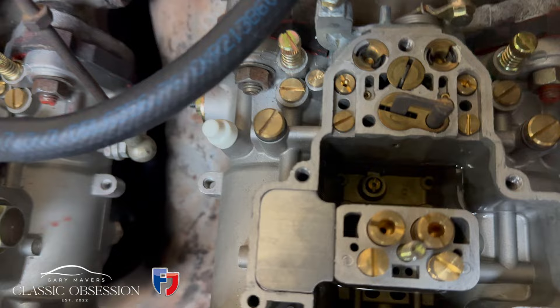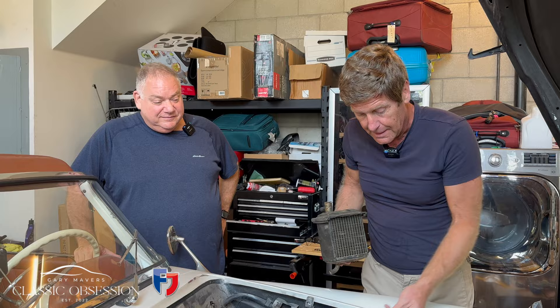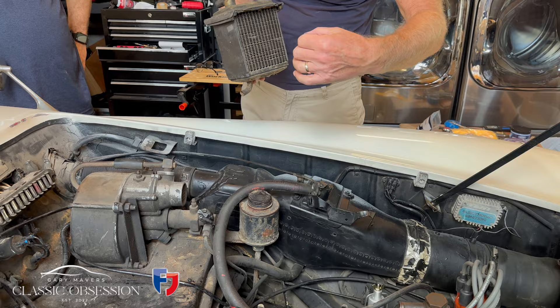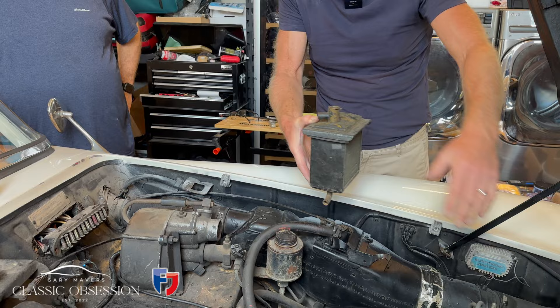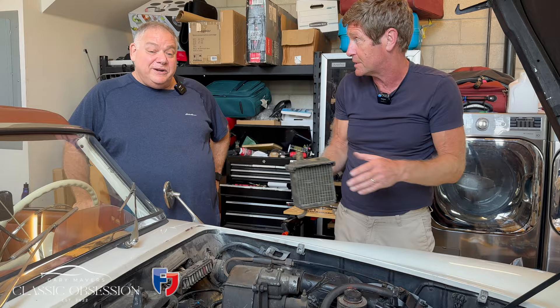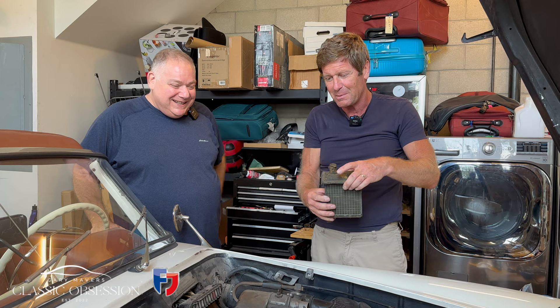After priming the pump and filling the chambers with fresh fuel, I call for Dan. The reason your heater isn't working is when you pull the cables inside, this should move this — but these are stuck solid. You've got a little brass barrel inside and it becomes full of crud and just jams up. When you pull your cable, it'll open the valve, your hot water flows through, it blows through your air vents, and that's what gives you heating. So both sides are stuck solid — the car's just been sitting up. But it's dual zone, one for each side — very modern, streets ahead of its time.